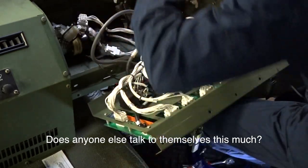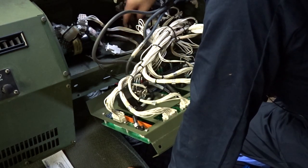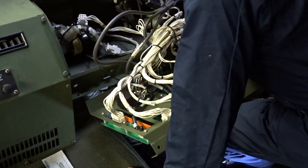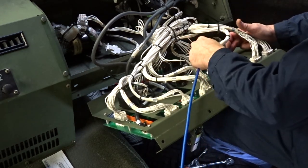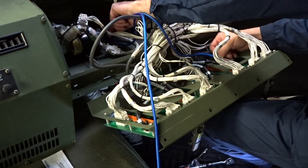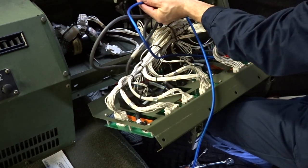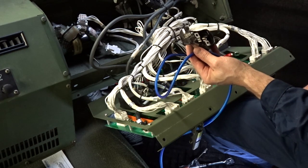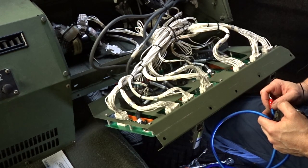The wire will go down there for easier access. We're going to go through this hole because it's already got a grommet. That's 12 volts to battery — connect like that, follow this out, down to there, hook into the fuse block. If this thing ever blows that thick dash apart — there's no place to put it on top, and there is nowhere else to put a 40 amp circuit without getting into some serious trouble.